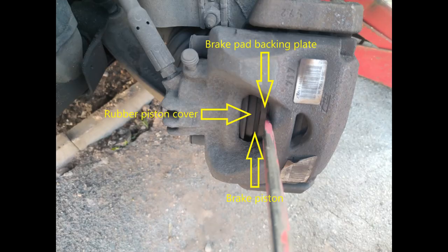For those that don't know fully what's going on - as you brake, a piston comes out of the caliper pushing the brake pads either side of the disc. As the brake pads wear down, that piston stays further and further out of the caliper, and you need to push that back into the caliper to enable new full-size brake pads to go in. This is a very good technique for doing that without a brake piston windback tool at all.